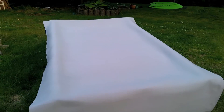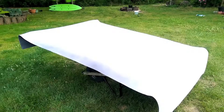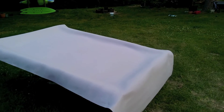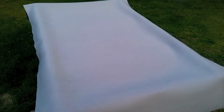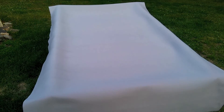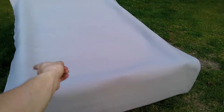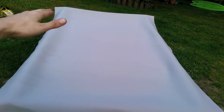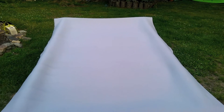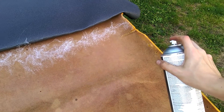We're gonna take our headliner and lay it across the whole board. The easy and proper way to do this is to center all your cloth on your board, then take half of it and flip it over and do one half at a time. Don't spray the whole board and then try to get it on there — it's just not going to end well. Just do it in halves. We're going to do three coats: two in one direction and the third in the other direction, then do the back of the foam. Let this sit for five minutes to tack up.